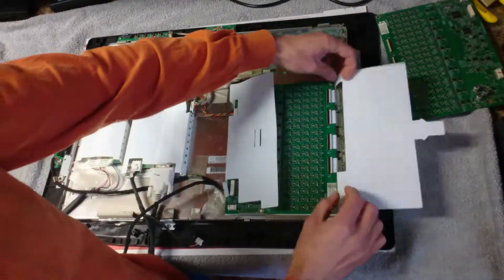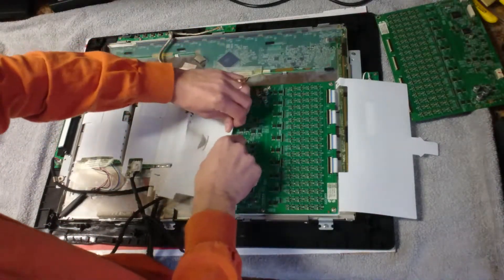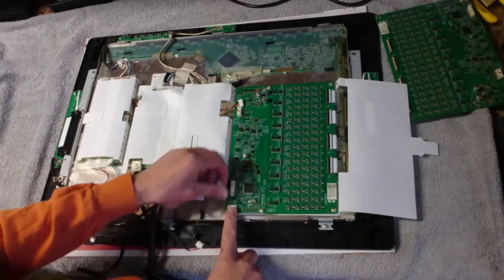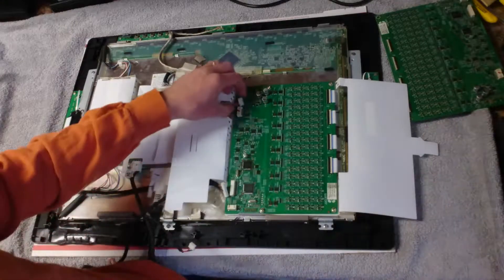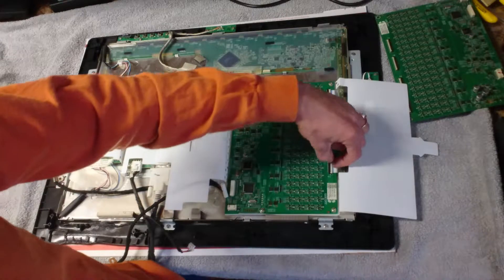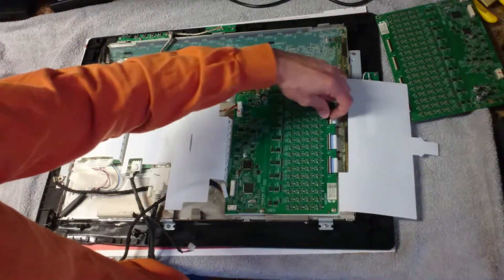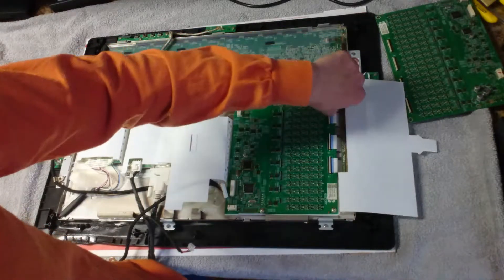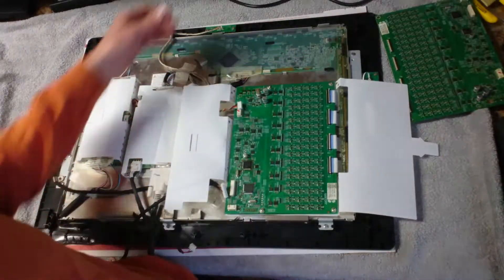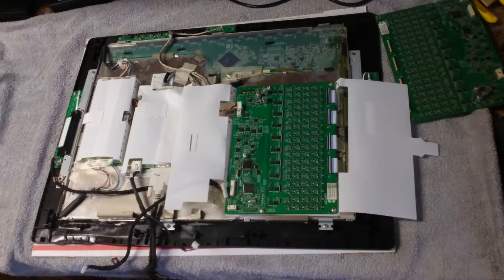I like to crease back these so they're well out of the way. The plastic will snap back once you put it back later — not a big deal. So there's the USB plug here, the plug going to the side buttons and digitizer, and this goes to the main board and powers the board at 12 volts of power. And you've got four ribbon cables — you're going to want to pull back the tabs. I don't know if they're called ribbon cables or flat cables. And we've got four screws on the digitizer board to unscrew — Phillips number two.